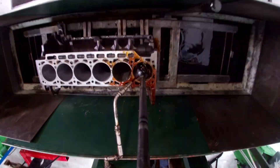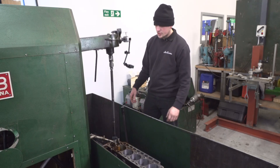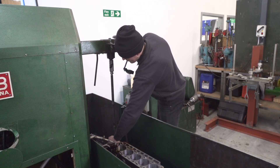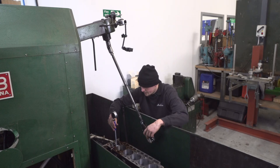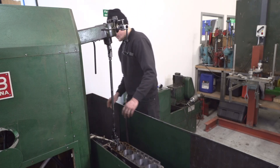As we can see, the head is now going up and down — it's coming out the top just enough and going down the bottom just enough. We've got plenty of fluid going in there, so everything's keeping nice and lubricated. My counter's coming down, so I'll let it run for another ten strokes, then stop the cycle, bring the head back up, get the stones out of the way, and get our bore mic in there to see what measurement we've got. After that pass, we've actually got a bit more meat to come out of the top, which is fine — the machine can cater for that.